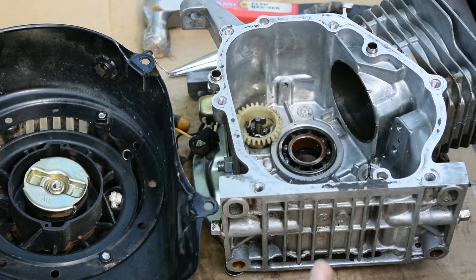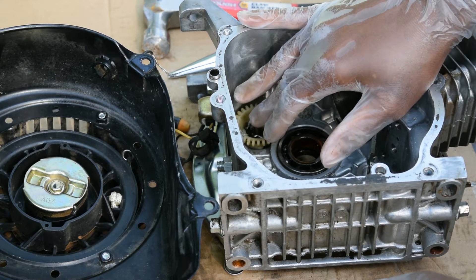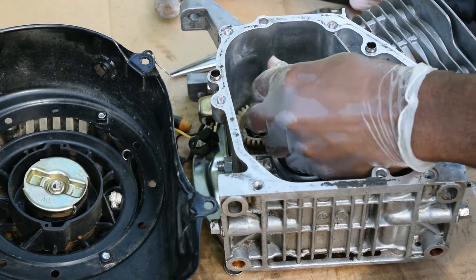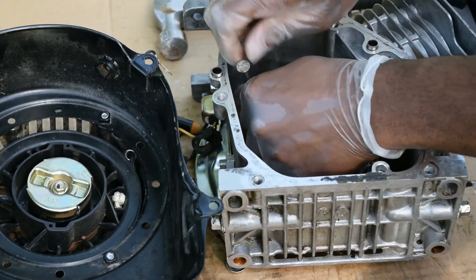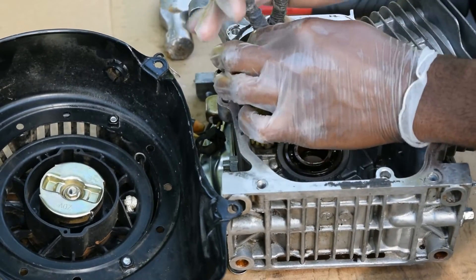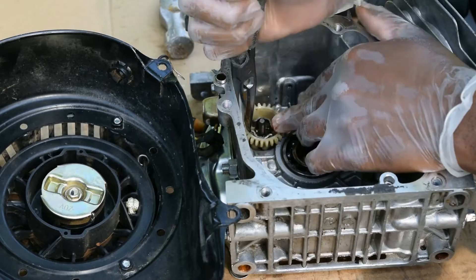In all respects, the governor is going to make you run at lower RPM, which basically means you're going to save the motor over the long term. That's probably what the company is thinking about — product returns and things like that. It's a simple plastic little governor gear that slows the motor down on purpose, so you don't have customers coming back saying the motor blew up. Well yeah, if you're running it at eight thousand RPM when you only need to be running it at five or six thousand.